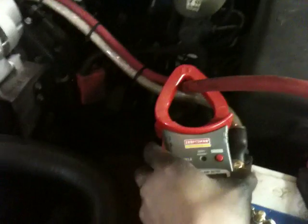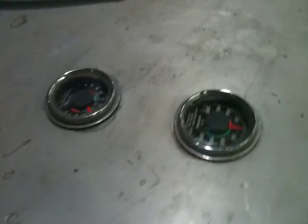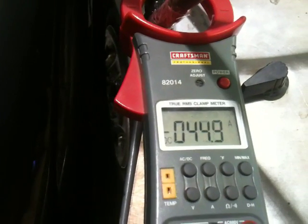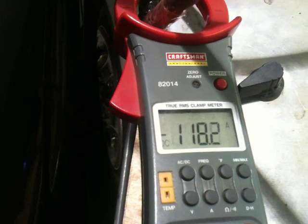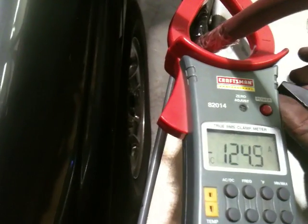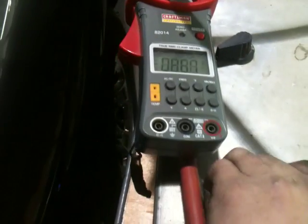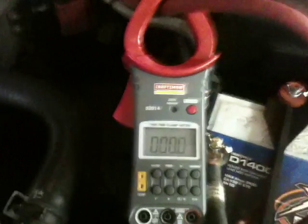We've got our standard 400 amp clamp and our two industrial 200 amp load banks. Each one of these load banks provides a 200 amp load against the electrical system — we can control that in 40 amp increments, all the way up to 200 amps. We'll take this amp clamp and clamp it around the charge cable of the alternator so we can show you what just the alternator does, and we'll have Josh start the truck up and load it down.